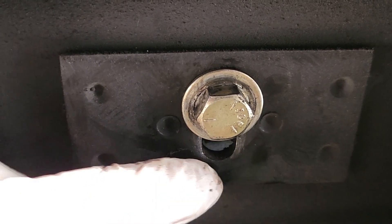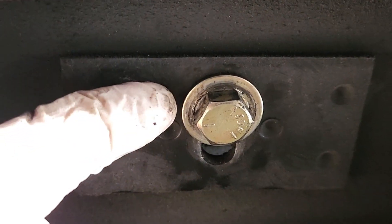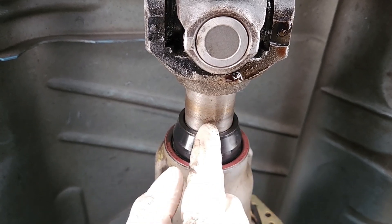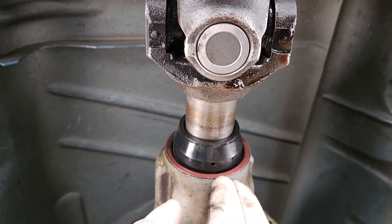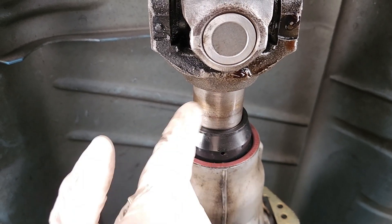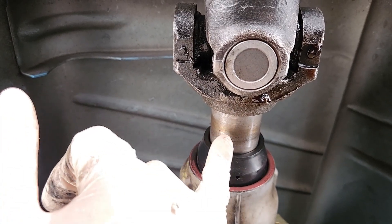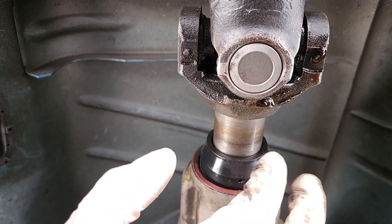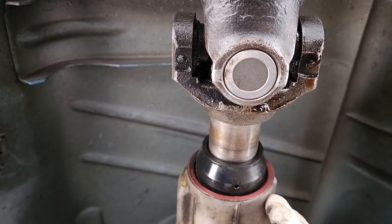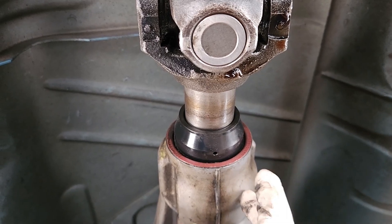Make sure your motor mounts are in place, then push the engine and transmission as far back as possible. You want the transmission to slide as far as it can onto the shaft — if the shaft is barely inserted, it could cause damage. The transmission was bolted down first before checking shaft depth; the difference wasn't much in this case, but always check before bolting down the transmission mount or engine mounts.